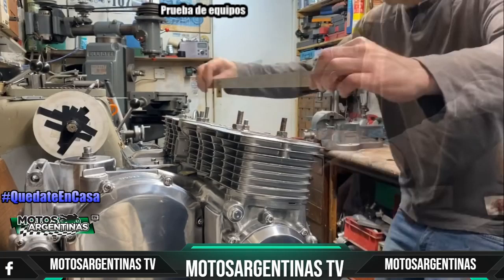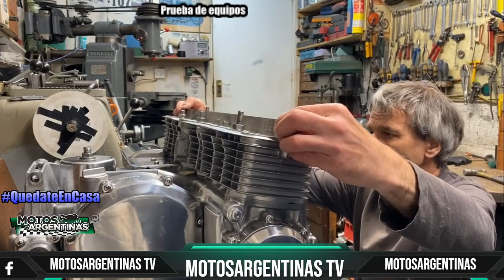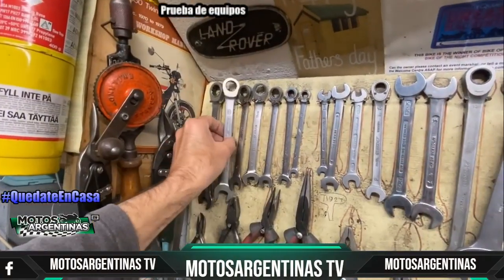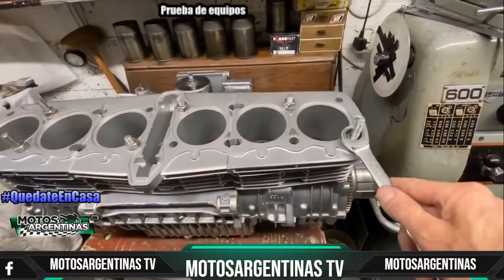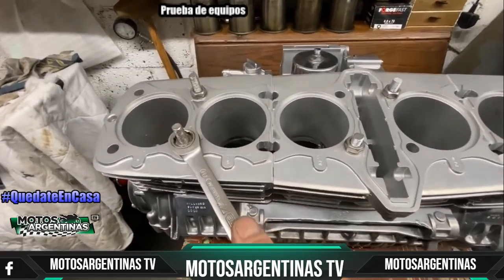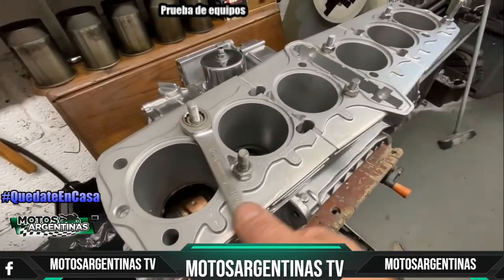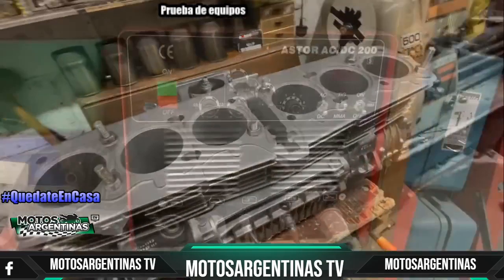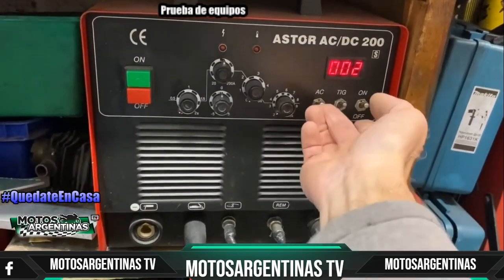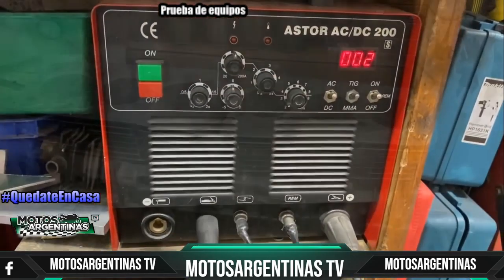With the liners removed, I double checked that the head was still flat, and it was, perfectly in line. So I got my 17mm spanner and tightened the studs down to hold the 3 bits of barrel in place tight on the crankcases, ready for welding. With all the bolts tight, I switched on my TIG welder and connected the earth strap to the barrels.